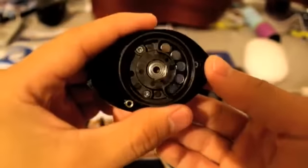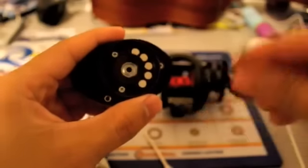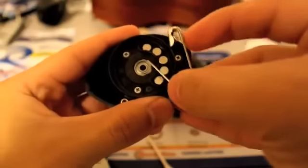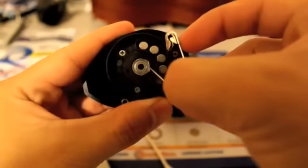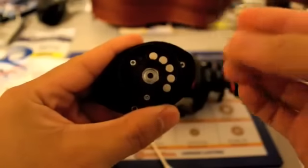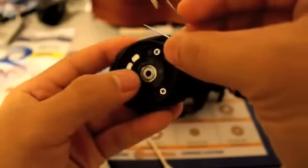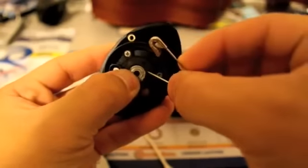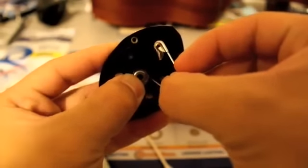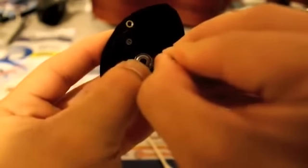Now that we have the side panel out, we're going to be using our safety pin — or paper clip if that's what you have. There's a small little wire that goes around the bearing, and what that does is it helps the bearing stay in place so that when you do change your bearings it doesn't fall out. The easiest way to remove that is to place half your thumb over it and then get your safety pin. The reason you want to place your thumb over it is because if you don't, the spring might just jump out of there and you'll lose it forever.